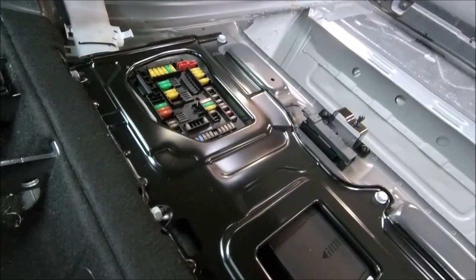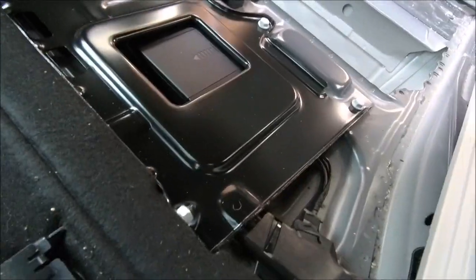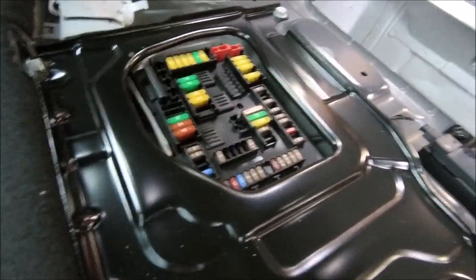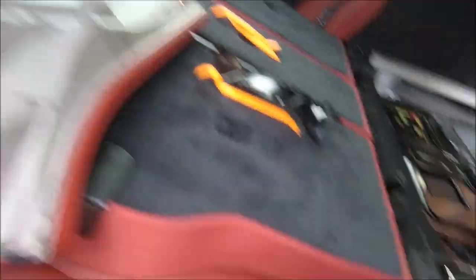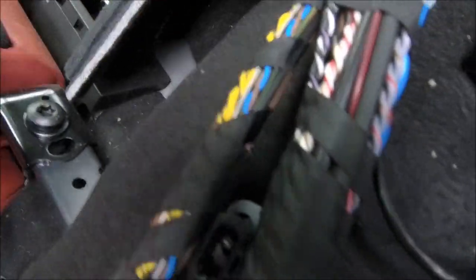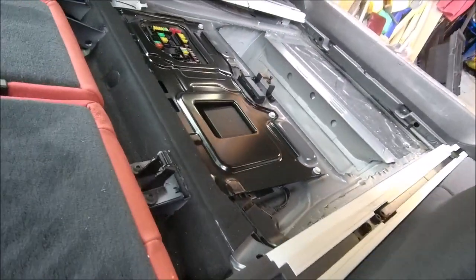Pretty much in the area we want to be now. I'm going to feed the box through underneath this panel here and bring it out somewhere up here. Then we'll start linking it, as we did last time, down the back here and up into the headline. As before, pop that little cover off there, and right down in there there's a clip — release that clip and then the bolster will come out. Clip at the top there released, bolster out. We've got plenty of room to get through underneath the panels and into the fuse box.